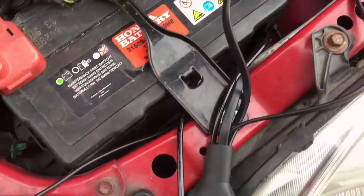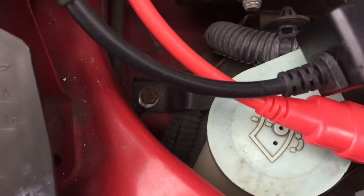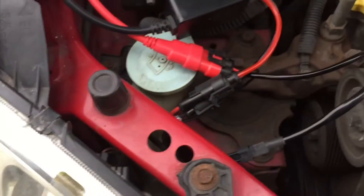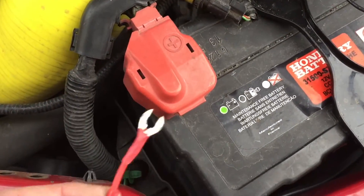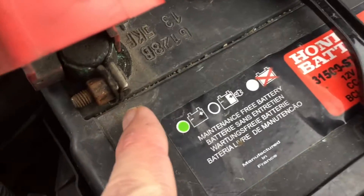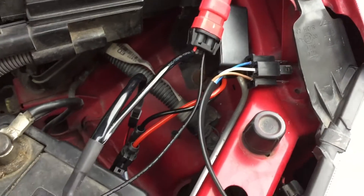So I've kind of routed the wires where I need them to go. I've connected the neutral on the passenger side to the battery since that's a common earth — it's fine. The other one I've grounded just down there on the mount for the ABS pump, so that's just down there out of the way. I've connected everything else up, so I'm just going to do a test run to make sure everything's ready to go. All I need to do is connect my live to my battery — there's a nice 10mm bolt there, nice and simple. It's easier if you slide the connector in between these two plates as it gives a nice solid connection when you bolt it all up.